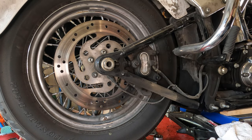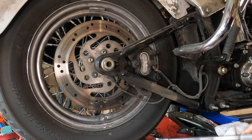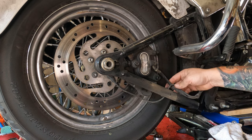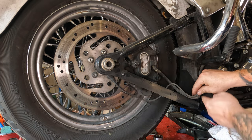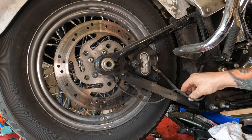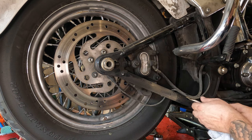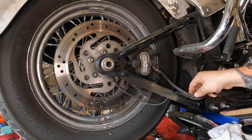To remove your rear brake caliper, you're going to take out this bolt here and this bolt here. Before you do that, down here you see these little clips? This is your ABS sensor. If you have ABS, you're going to want to take this little clip and pop it off of the brake line there. Keep track of those little clips — you're going to need them later. If you lose them, you can probably buy more or just use a zip tie. And before we take this completely apart, we're going to have to bend up this metal tab here carefully so we can take this brake line out.